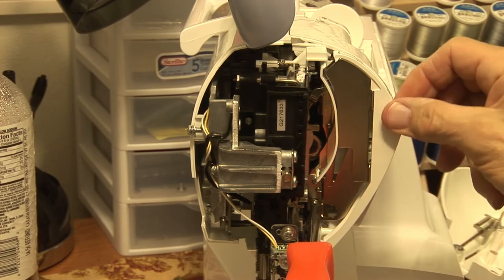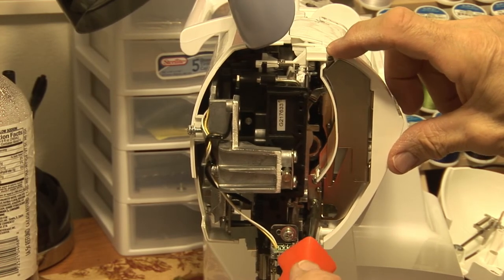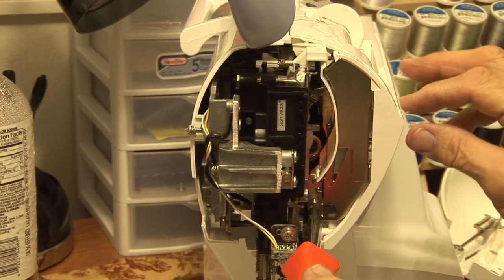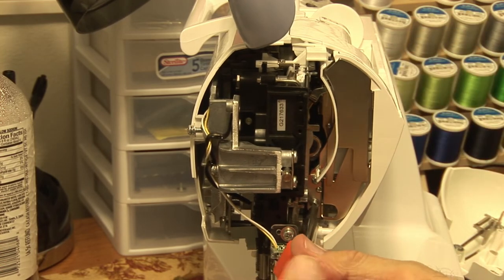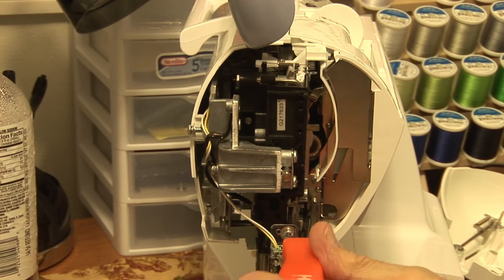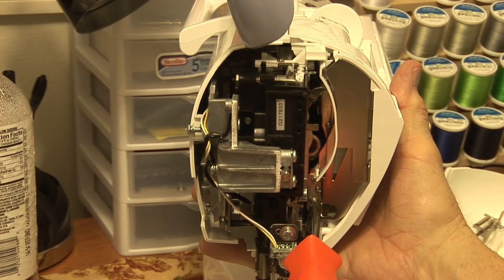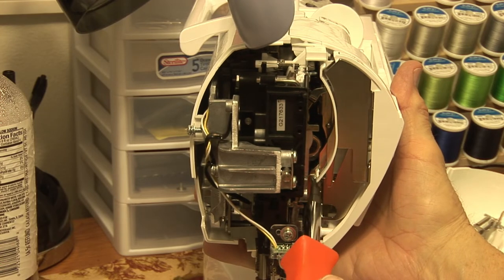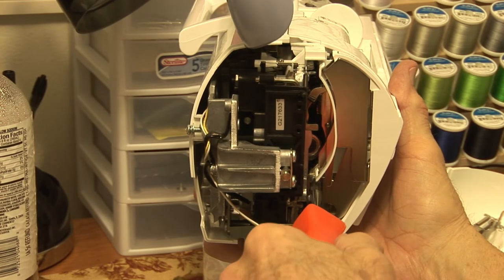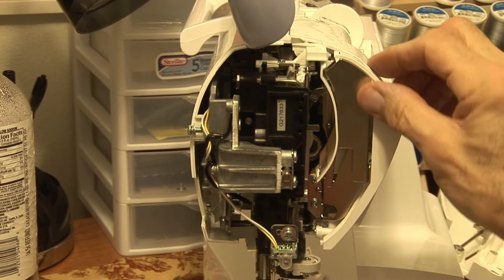you tighten, you jiggle this. It's always good when you tighten the screws, you jiggle the thing, it aligns it. You jiggle it, make sure this is aligned. And you line the screwdriver up so that it's in line with the screw that's going into the thread portion, and you snug it. When you snug something, you concentrate on that: I'm snugging it. Concentrate. Not that you're just putting it until the screwdriver slips. All right, that's snugged.